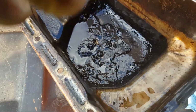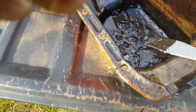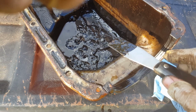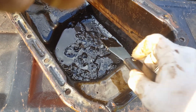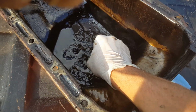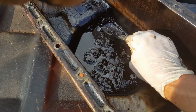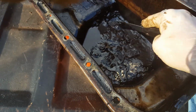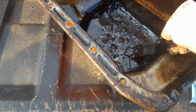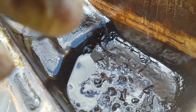Okay. Yeah, didn't smell burned or anything. And one tip I had about this that I figured I'd better look in here is I noticed the oil pressure light was taking a little while to go off. It was taking too long. Okay, good thing I didn't just run that like that. It would have shortened its lifespan for sure. Okay. Put this on the list of stuff to be cleaned.